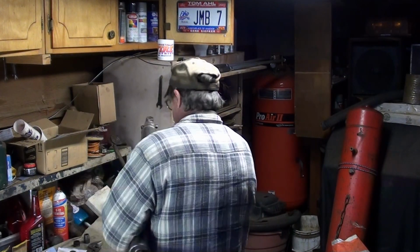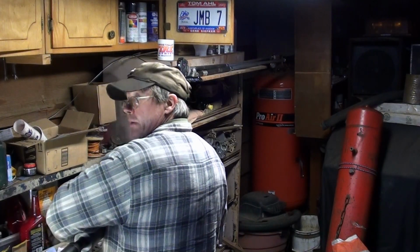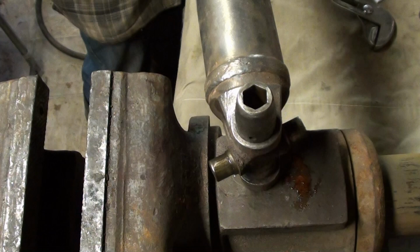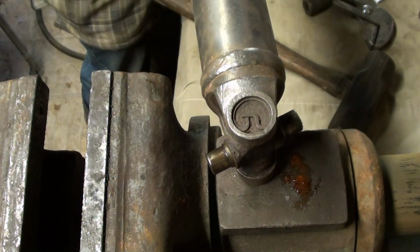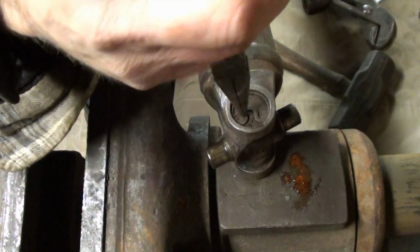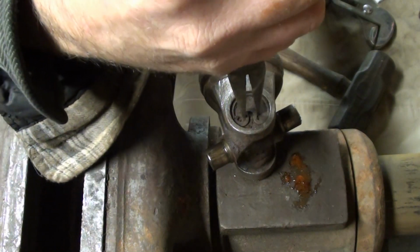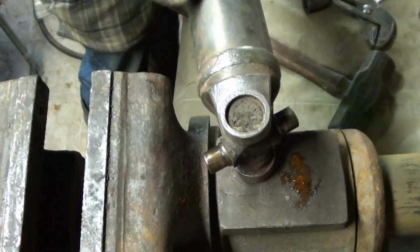So, using the third hand technique without a third hand, set yourself a socket on there for that clip. Give it a pop. Grab your needle nose pliers. Roll up one side or the other, don't matter. And release.